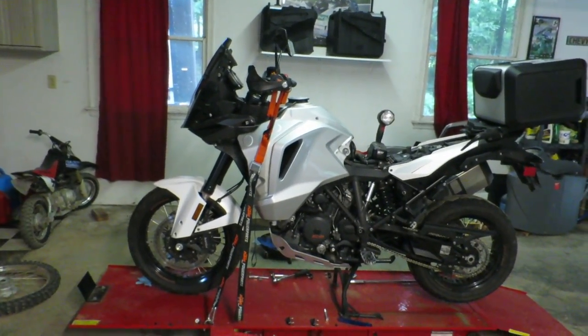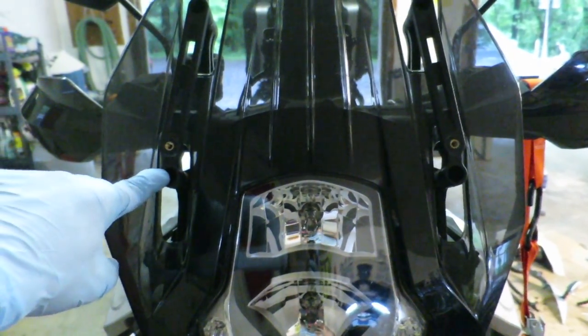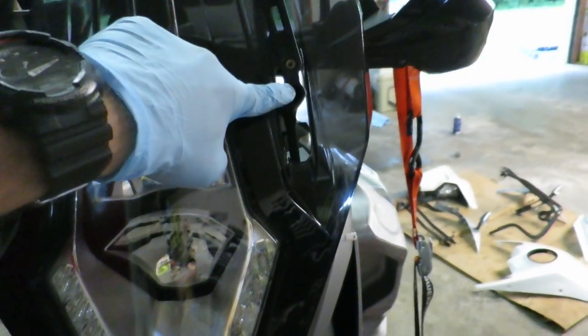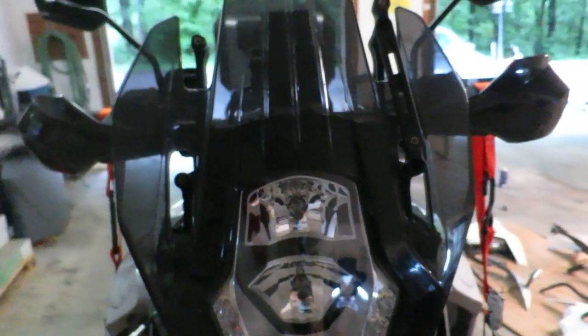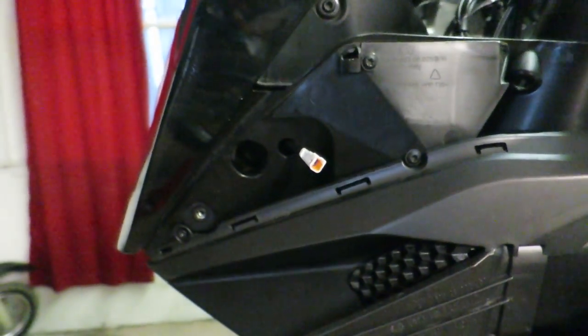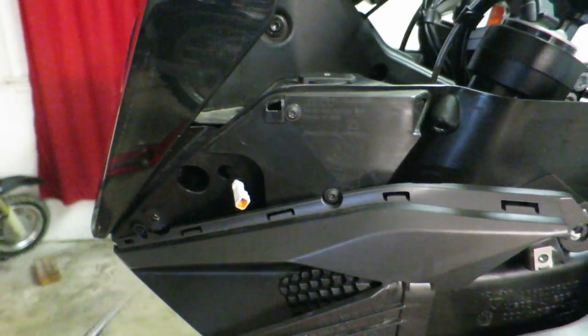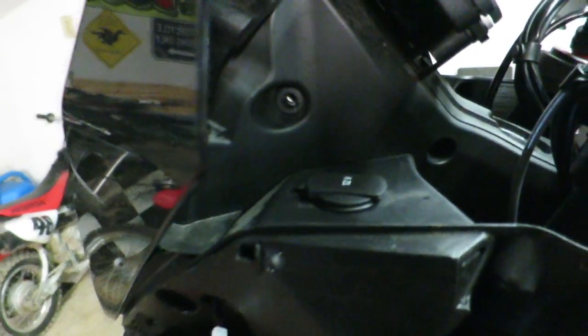Now that we've removed all that stuff — your bike should look about like this — it's time to remove the headlight assembly. Step one of headlight assembly removal: you have four screws, one here, one here, one here, and one here. Take all four out. Over on this side we've got two screws right here and one way back in there — same thing on the other side. They are all the same Torx head bit we've been using this entire time. Just FYI on that top one: there's a little collar on there, make sure you don't drop it. With all four screws removed, unplug the headlight from the harness — just unplug that — and we can finally get to work on replacing the bulbs.